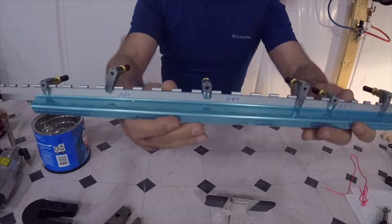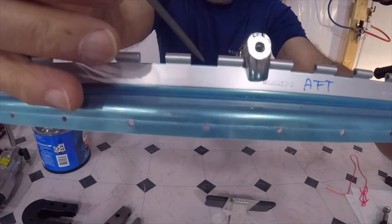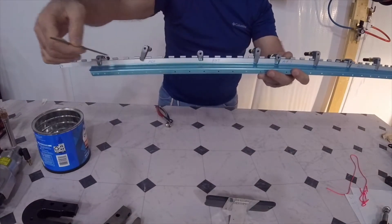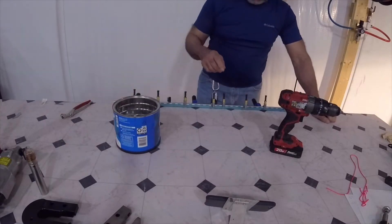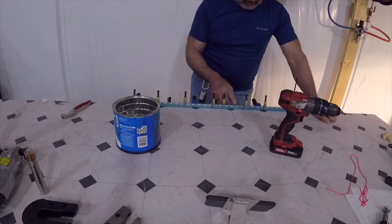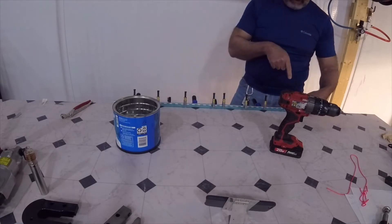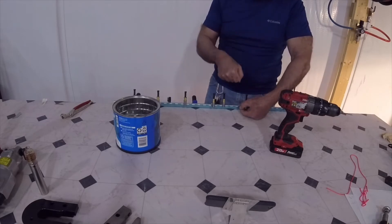This is what I was trying to tell you about how to gauge it. This area right here — when you look from behind, from this section, they're all the same. Now you know it's parallel to the edge. After I clamp the hinge to this — like the front spar of the trim tab — the other end I clamped to the table. It's somewhat flimsy, so while I'm drilling I have to hold it with my finger so it doesn't bend down. Take care while drilling. I finished match drilling all the holes.